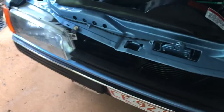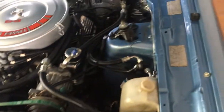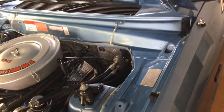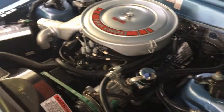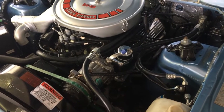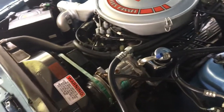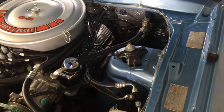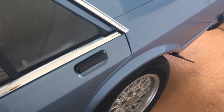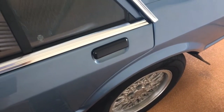They run an oil cooler and a transmission oil cooler. Some of the other model police cars used for highway escort of big heavy loads often got additional cooling — additional oil coolers for both engine and transmission. This one's got power steering even though it's not listed on the option list, so I'm assuming the police cars got power steering. Being an XE with the V8, it's got the bigger diff — the 351 diff, 28-spline, 277 rear. I'm led to believe the original highway patrol car had a 2.53 diff gear rear.